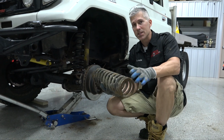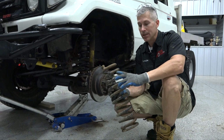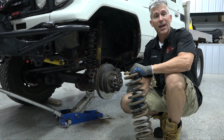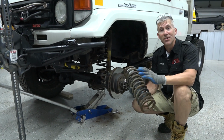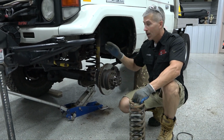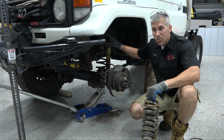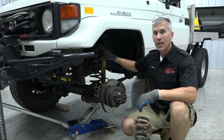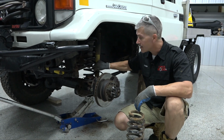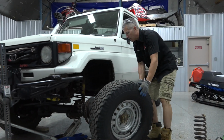If you really think about it, all this makes sense. Now this coil spring has equal spacing between all these coils, and equal diameter of the coil, or the wire you might call it, the whole way. It's a very heavy duty spring, and you're going to feel the bumps on the highway. On the little roads, on the smooth roads, you're going to feel it because it's such a heavy duty spring. And I do feel it on this truck, there's no doubt about it. Now with these smart coils, you're going to notice a difference. Because of this tapered section up here, it's going to absorb those little daily driver type of bumps, if you will. You're not going to notice the road as much. But when you get off-road, you still have the nice thick dimensional wire down here to take up the big loads.